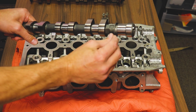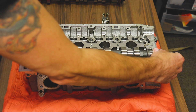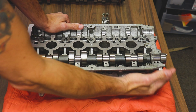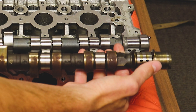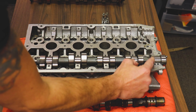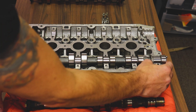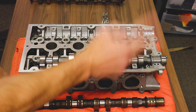So one of the things I had to do is remove about one-tenth of an inch off the thrust surface. When we put this camshaft in here, you have a few thousandths of an inch worth of play. I measured one of the stock camshafts, and you can even tell that how this thing is cast is a little different. The amount of meat right here on this thrust surface was different. I took it to a guy with a machine shop — he charged about $150 for the hour and we machined the surface down. I'll show that video here.